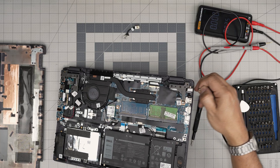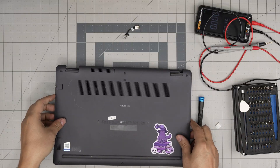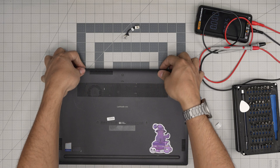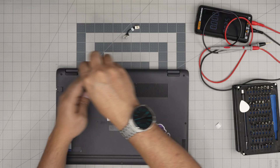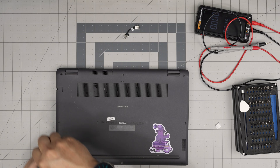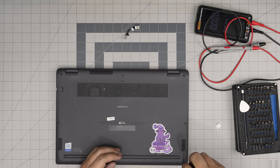Once you're done with that, disconnect the charger and continue by placing the top cover back on. Bring it down, squeeze the sides, squeeze the back. If you see any gap opening, just pinch them together. And that's how you can replace the power jack for your Dell Latitude 3510. If you guys liked this video and it helped you out, please support the channel by clicking like and subscribe — I'd greatly appreciate it. If you have any questions or requests, feel free to leave them in the comments. Thanks for watching and I'll see you guys in my next video.